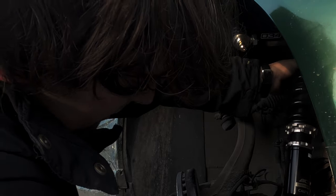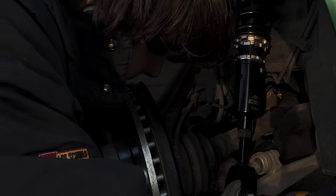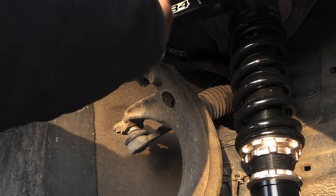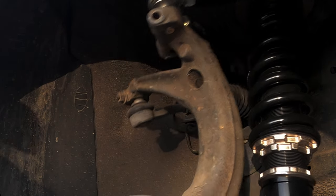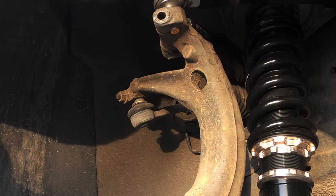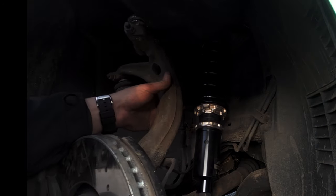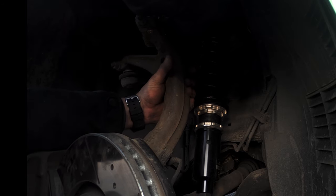You can choose to reinstall the bolts in pretty much whatever order you'd like — some orders are easier than others. On this side, I started with the bolt on the lower control arm and then moved on to the upper control arms, followed by the bolts that go in from the top of the engine bay. For that part, you're going to want to use a jack to push it up into the right place. You're also going to reuse your friend the mallet to persuade these new control arms into their new home. After using a wire wheel to clean the inside of the spindle, these go in pretty easily. The final piece of the puzzle is to use a jack to jack the entire suspension assembly upwards, then you can easily thread in the bolts from the top of the engine bay to keep the whole system in place. After that, you can jack the car up even further to mimic ride height in order to torque down those two upper control arm bushings. And that's really all she wrote for this.